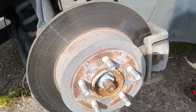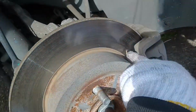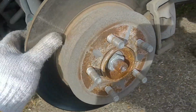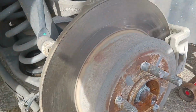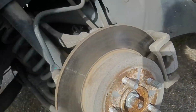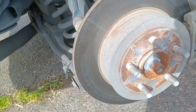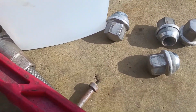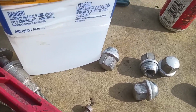Looks like corner number 2 is pretty much the same story. Thin pads, minor corrosion to rotors, trying to make pads stick. There's a few more grooves on this one from the squealer shims. Nothing terribly wrong with the rotors, but some new ones would put it right for the next 100,000 miles. A little bit of the Chrysler lug nut disease, not too bad, but I did have to put a little bit of a stripe on them. We'll talk to the customer about that.